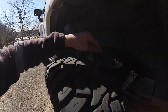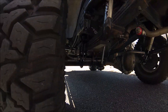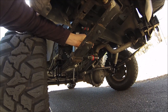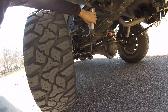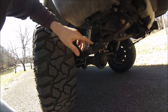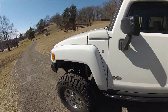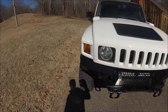We have warn lockouts and ABS hubs from Thor Parts — keeps all your dash lights happy. In the rear we have the same urethane bump stops. We've done a spring over in the rear using a Rough Stuff kit. These sway bar links are from a late-model Dodge truck — extended sway bar links — and we're running 10-inch travel shocks on the rear.